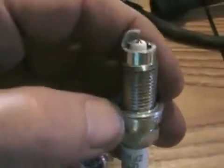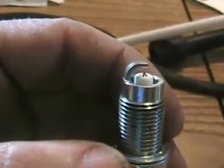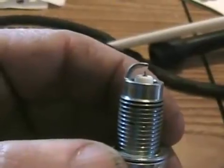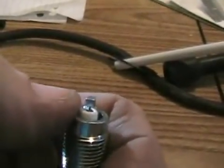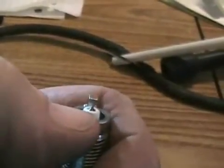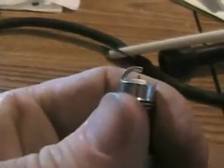This one's a platinum plug. Platinum plugs have a lot smaller tip, and there are two reasons for that. One is platinum's very expensive — more expensive than gold — so the smaller the tip, the more money they save. But two, the spark has a defined point where it can jump. It just can't jump all over that flat surface on a larger tip, old-fashioned spark plug. This makes better control of burning the fuel and possibly better performance in fuel economy.